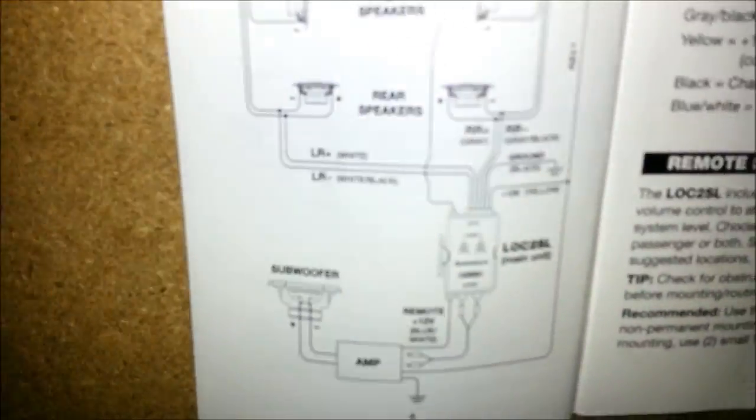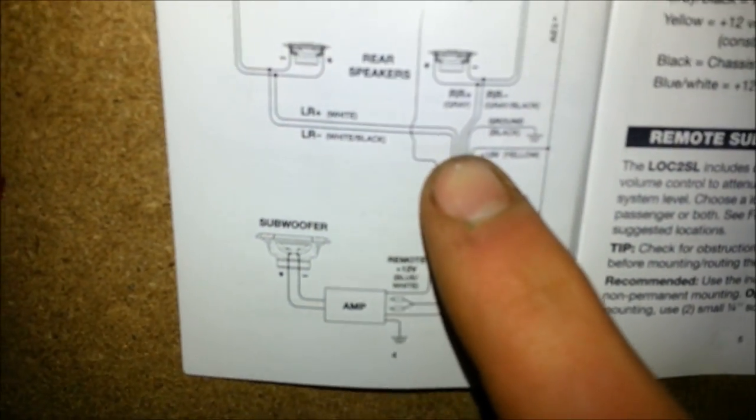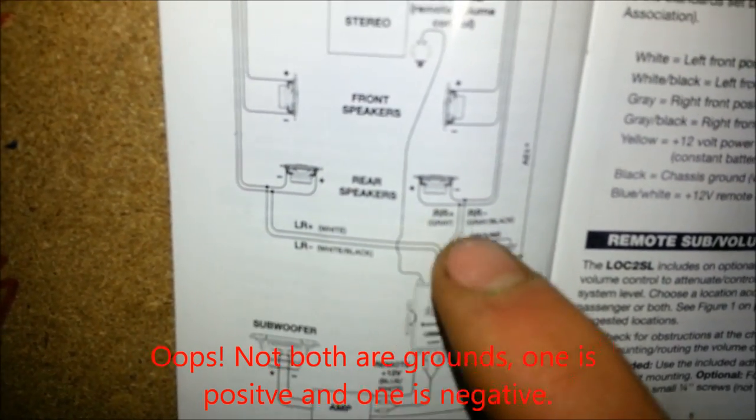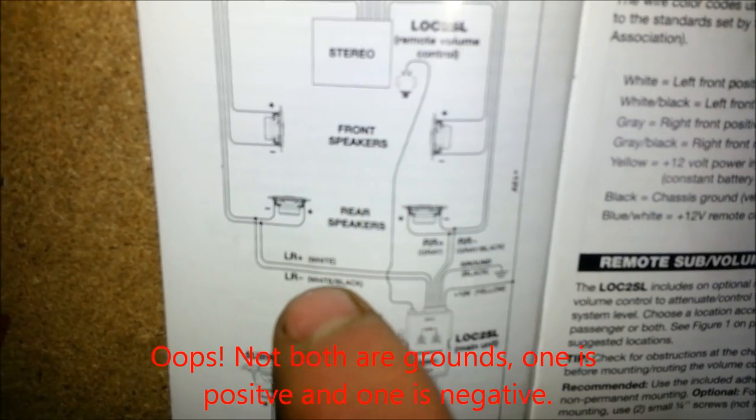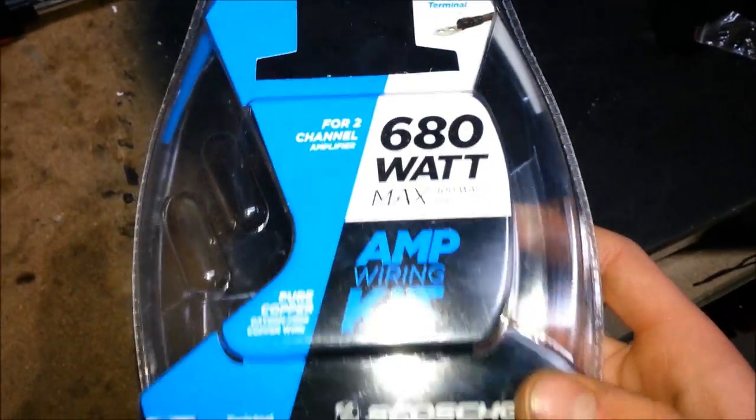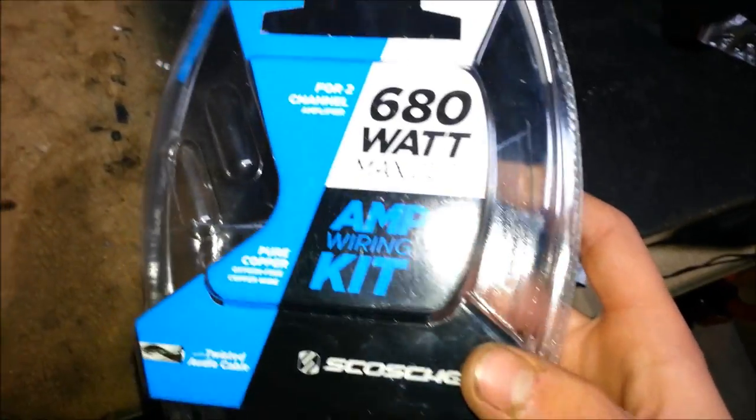It comes with this wiring diagram. As you can see, here's the adapter — there are the six wires that come off of it: two of which are ground, and four of which go to your speakers, two to the right side and two to the left side. Determining which ones are your door speakers is going to be based on your vehicle. This is the actual install wiring kit for the amp, 680 watt rated — it's $20 from Walmart. It's cheap but it does the job and works well. That's pretty much what covers the install. Any questions, you can message me or leave a comment on the video.